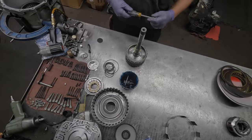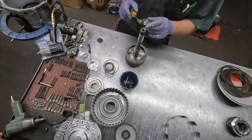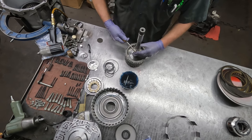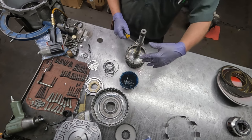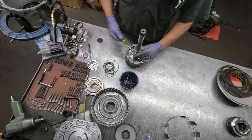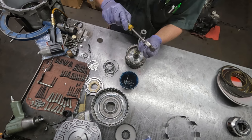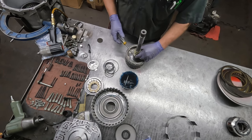Okay. They probably do have a sizing tool for this. I never got one, but if you're doing this at home, trying it on your own, you can use a hose clamp and just tighten that around to get it to size into the groove. You just want to be careful that it doesn't get out of the groove and that you squish it onto the flat or twist it or gouge it. And you don't have to go especially tight with it. Just get it in there, because if you go too tight, then you start printing the worm grooves onto the sealing ring, which is not really what you want, because then it might not seal quite as well.